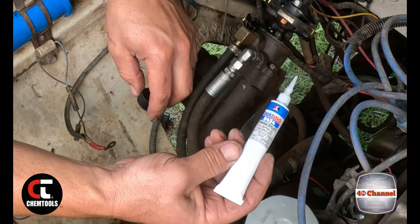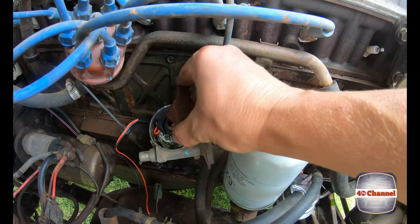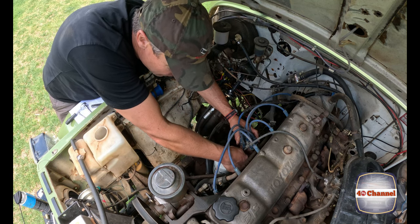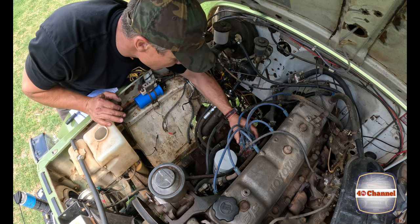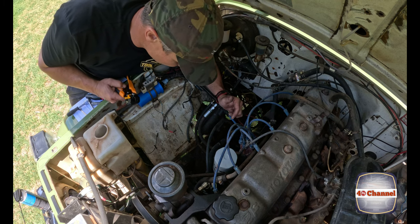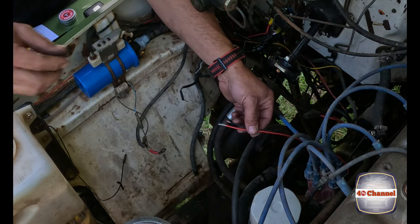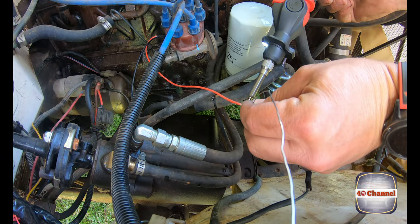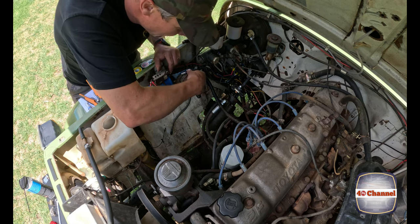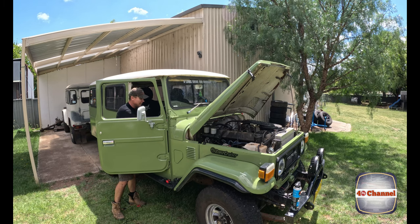We're going to use a tiny bit of 8454 Rapid Stick — just put a tiny little dob on to stop it moving. We refit our rotor and can throw the distributor cap back on. Plug anything back up that you might have unplugged, make sure it's all nice and firm. Now we need to hook the wires up to our new coil. The only recommendation for this kit is that the wires be longer, because as you can see we're way short over here — but not a major drama. Wiring up our last little bits and pieces, tightening everything back up, and now we should be able to turn the key and see what happens.